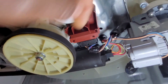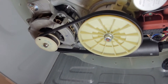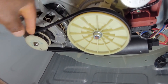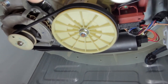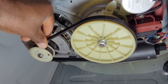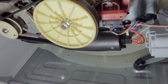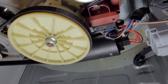Next to that you have this black part right here — it's a capacitor, a drive capacitor. Motors in general, when they are about to start spinning, require a lot of energy, because not only must the motor overcome its own weight but also the weight of everything it is attached to. This entire thing is tied to the basket, so driving this means driving the entire basket. The motor does not have enough energy to turn the whole thing the first time, so engineers came up with a device called a capacitor, which stores energy and provides it to the motor when it is just starting to turn — it's like the battery in your car.